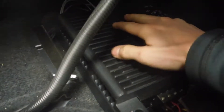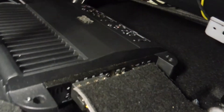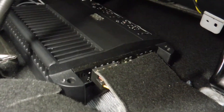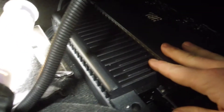Unfortunately there is a problem with mounting — there's a ridge right under about here, so the whole unit rocks. There's just too much clearance under the feet to go screwing straight through. So what I'm doing is making an MDF baffle which will be the exact footprint of the amp, going under it. It'll be nicely painted black, simple, and then that will be secured onto the ridge with a few screws down the center. The amp will then secure to the baffle — just tidy the wires and carpet up a bit and it'll be finished.